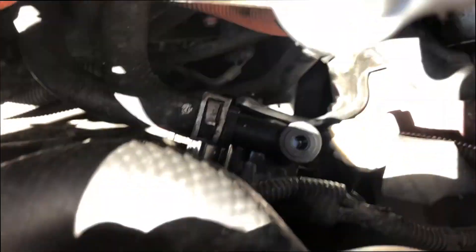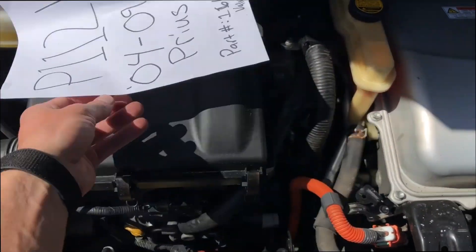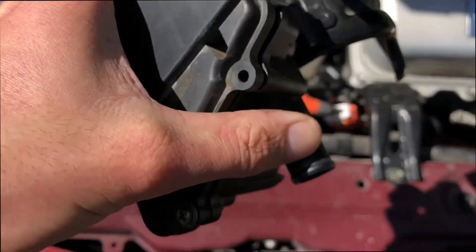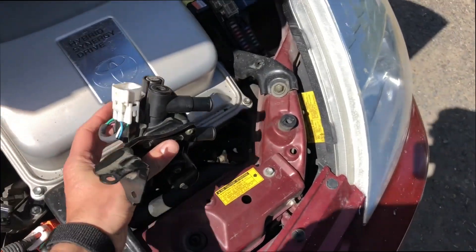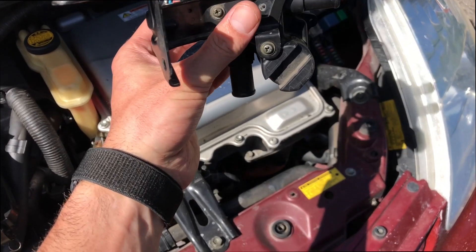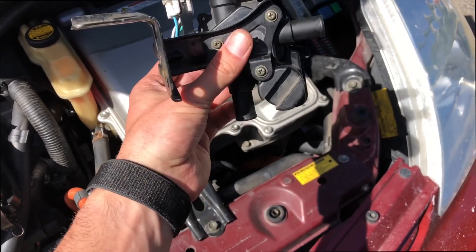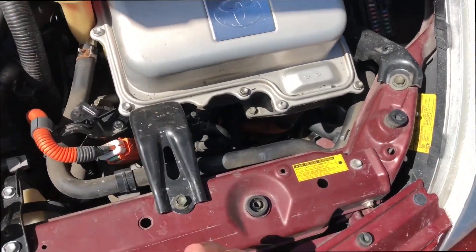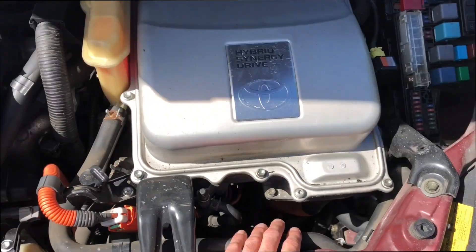There, you can see it right there — that is the valve. So really, there's my tip: take it out from the top. Take these two bolts out. Lift this inverter up. Do not remove this hose on this valve. Remove the whole valve out this top cavity with that hose attached. Then when you put the new one in, attach the old hose on this part of this valve and snake the hose back through. You are going to have to kind of muscle it out and move some of these coolant hoses out of the way, but if you're just gentle about it, I got mine out no problem.